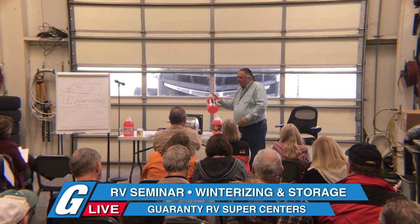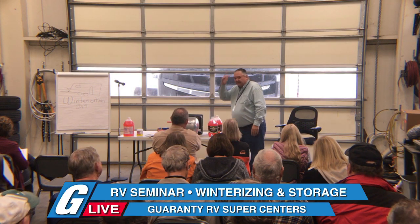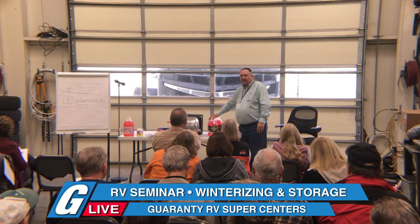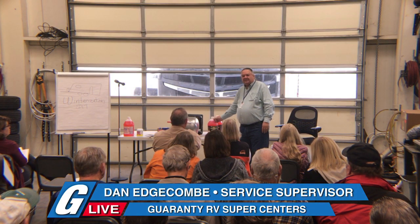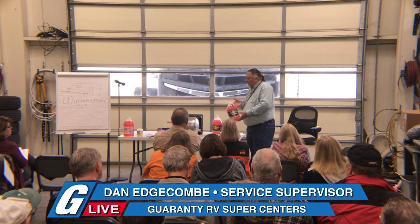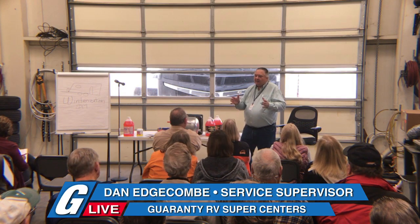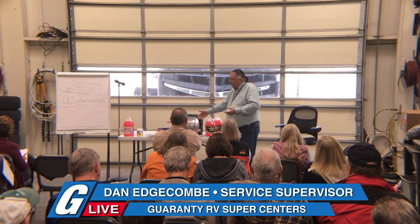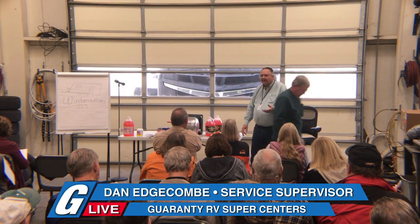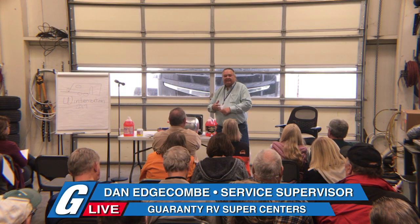This antifreeze is RV non-toxic. You can drink it. It tastes like mud, but you can drink it. It's not going to kill you. It's non-toxic. The interesting thing is when I was in college and I was just learning about RVs, a really nice old guy owned this RV shop. He said, you know, you put some of this in a glass and put it in your freezer and see what it does. And what it does is it freezes hard as a rock, but it doesn't expand. It will be in your lines frozen solid, but it will not expand, so it will not damage your plumbing. That's the difference. Water has a coefficient of expansion of around 10%. I think it's 7 to 8%.